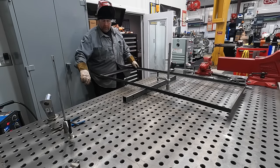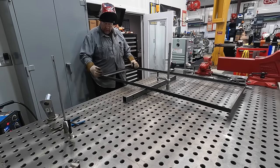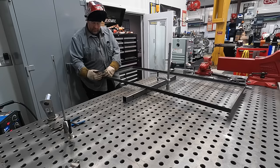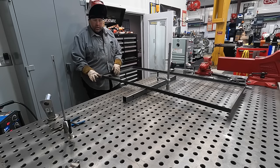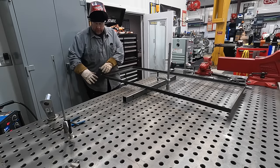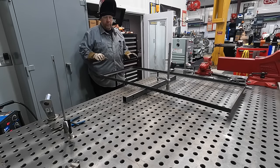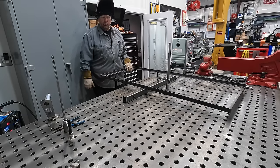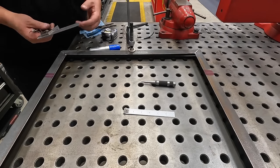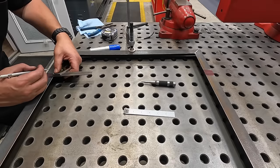I'm probably going to go over to the welding shop and see if they've got some drops of inch-and-a-quarter square tubing. We're going to have a couple more tubes welded along this area here, extending underneath the hitch, with some angle iron welded to the bottom of the hitch that these tubes will bolt into. I want it to be bolted rigid — no flexing and moving when it's mounted on the back of the camper. I'm also going to drill four holes in the frame to allow us to bolt the box down.